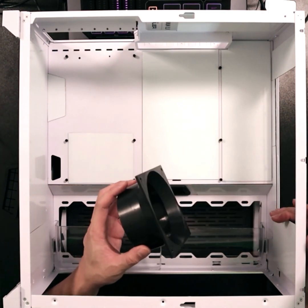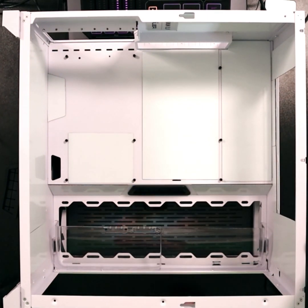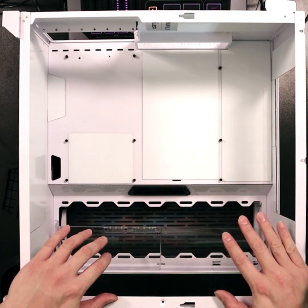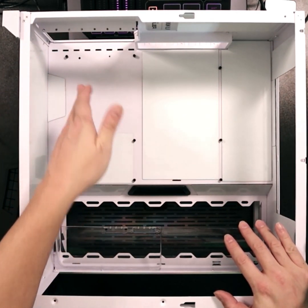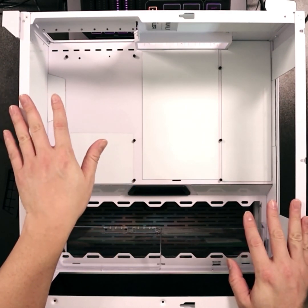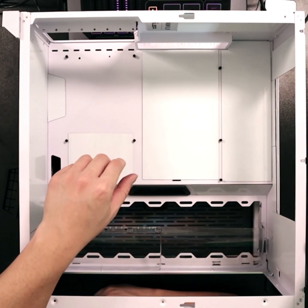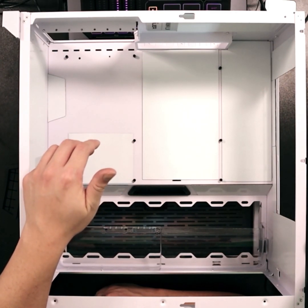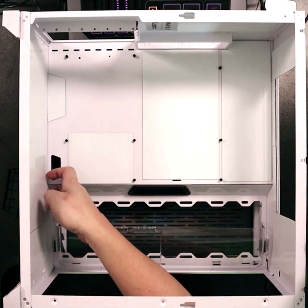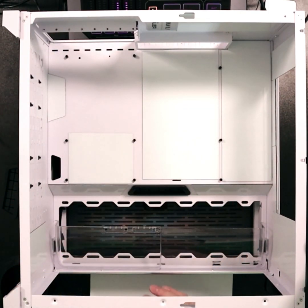I just don't know if this is even worth it, just to go with a minimal fan setup, you know what I mean? The other thing I was thinking of doing is, if I do go with the TRX40, the last slot can actually be used for a GPU. It would be running under 8X, which is exactly what I wanted anyways. The 16X would be for the PCIe NVMe card. I'm using the Asus one. And if I were to use the card, I'd put the card on the last slot and actually remove this.